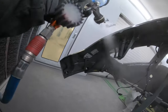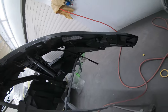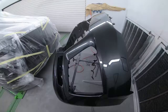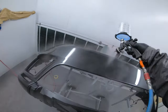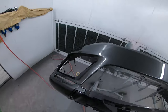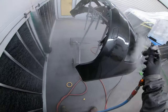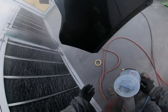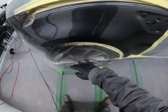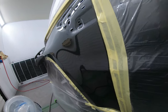You'll see now I'm just checking again — that wasn't quite as glossy as I'd hoped. Using the back of the glove to check, give it a little spray. There's two minutes left and I'm just checking everything before it comes out. I don't want to let this go out and then realise there's a dry edge that you'll struggle to polish. You don't want to be re-clearing this because of something so silly as missing an edge. So just go around when you're done and have a little look. You'll see what I was on about earlier with the colour match on the bumper — even though we flicked the wings it still wasn't quite right, but it was acceptable. The customer was happy. No complaints.